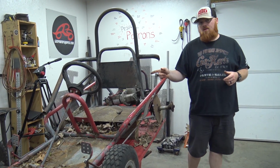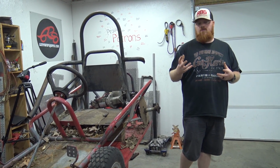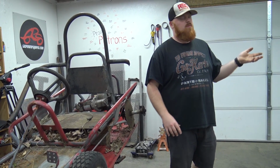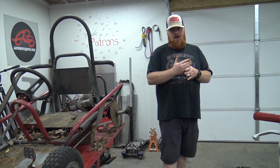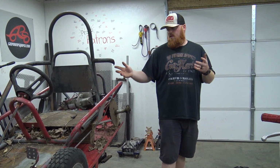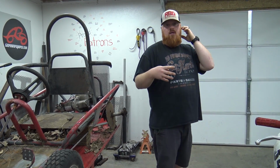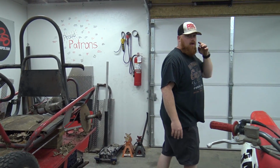We did think about putting that on a mini bike, but it's so wide, and I pulled the electric motor off the differential, and it's a really small spline shaft. I'd have to get something machined. It's just impossible right now. So if we find a really good electric motor, I want to run a 48 volt setup. This is 24, so you'd run two batteries in series or parallel to push out 24 volts, and for a 48 volt one, we'd have to have 4 batteries stacked together. So it'd be cool to mess with that on a mini bike, I think.